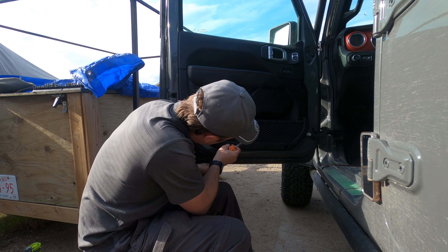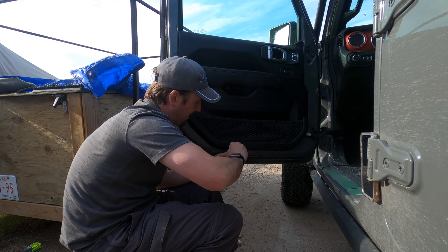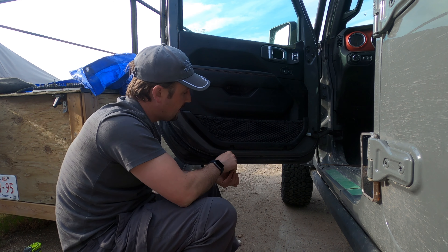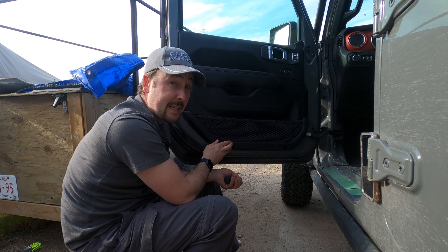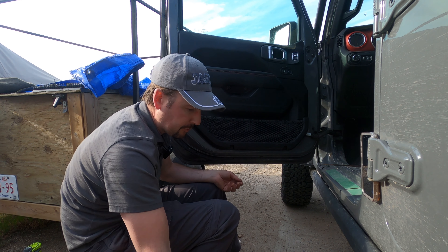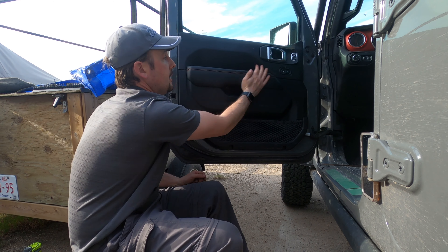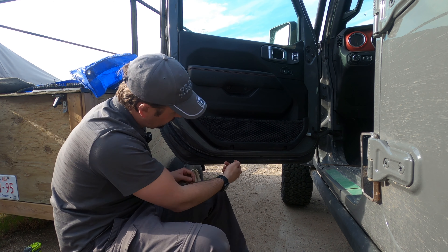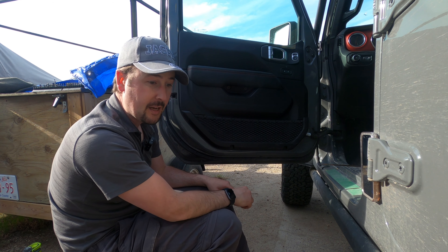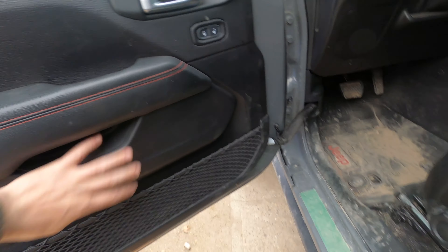Word of advice if you're doing interior work: don't use power tools. I'm just using a Snap-on ratcheted screwdriver — it's more than fast enough. It's very easy to break interior panels with power tools, especially plastics. Just take a little extra time to use a manual tool and you won't be able to break it unless you're really trying. With a drill it's super easy to go half a second too long and it'll crack. Then you'd have to bond the plastic to repair it — not the best idea.